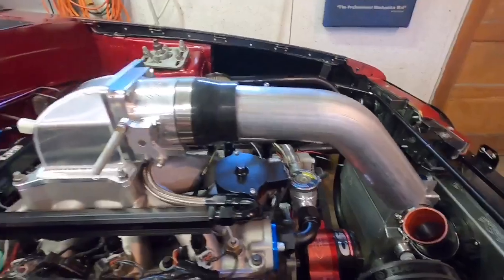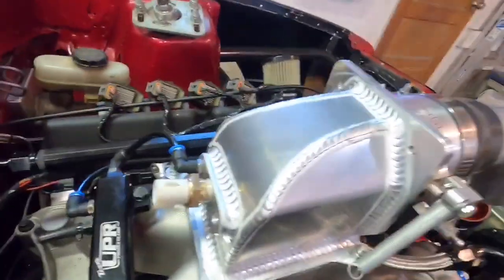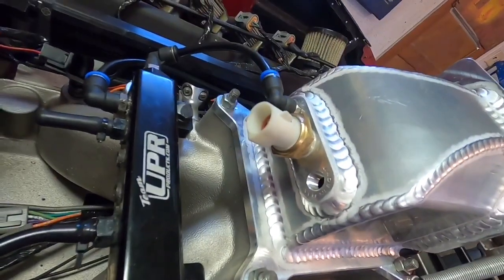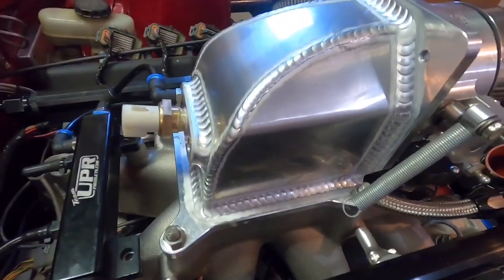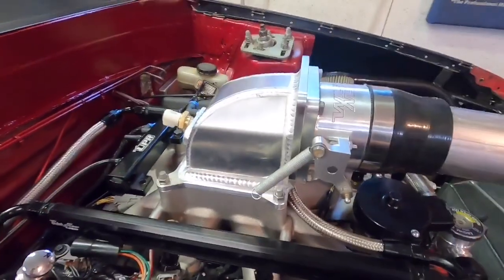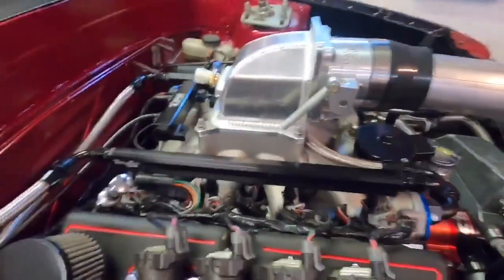It's going to line up perfect and looks really good. I've got my Wilson throttle body on there. This is double welded — welded on the outside and welded on the inside. It has the vacuum block in the back for my intake temp sensor and vacuum lines, so I don't have to weld a bung on there or anything. What's cool is it has o-rings on both the throttle body side and the flange side, so no more need for paper gaskets. An o-ring is just that much slicker. The quality is great, welds are great.